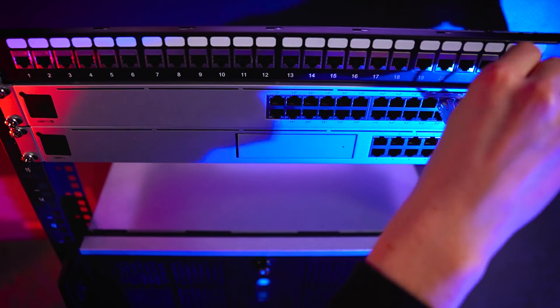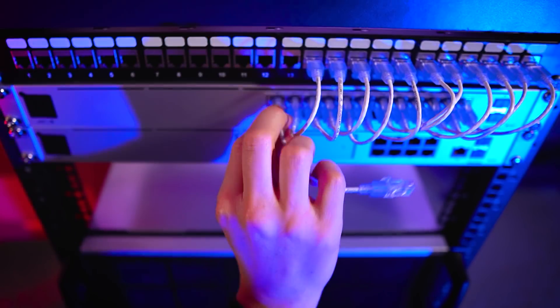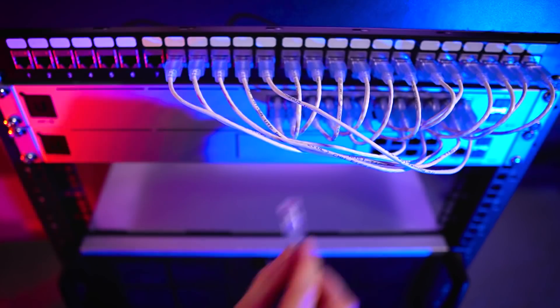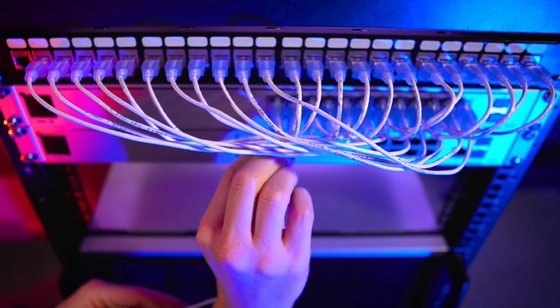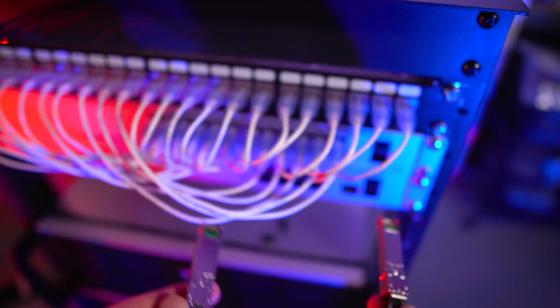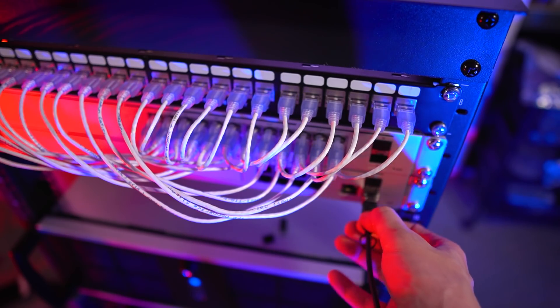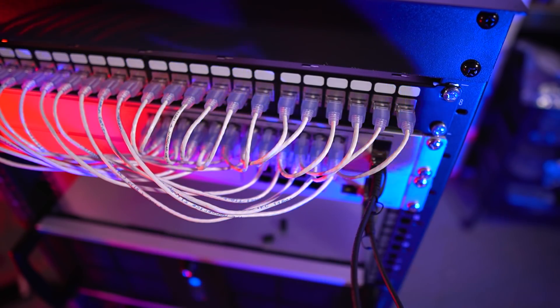Now we just need to wire up all of our new ports — this is my favorite part. I went with slim CAT6 ethernet cables; I bought both 6 and 12 inch cables to connect all the ports to my switch. I wish I had another half U patch panel so I could have used all 6 inch CAT6 and made it look nice, with extras for things like DAC, fiber, or even HDMI. Then I connected the DAC to the SFP Plus port on the UDM Pro to the Switch Pro, giving me a 10 gig uplink.